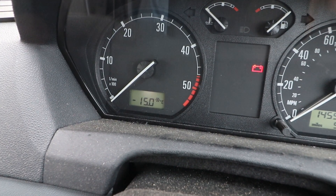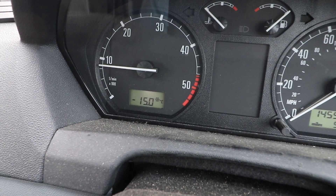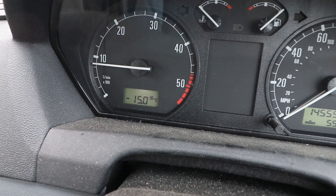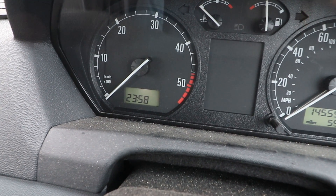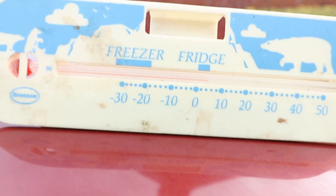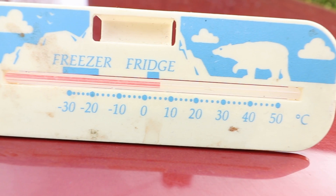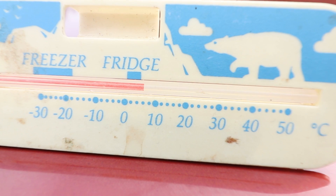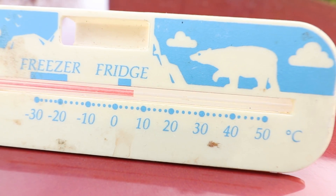Start it up to see if that makes any difference — no, it's just the same. I covered this in a previous video, so this is the video where I need an ambient temperature sensor by the looks of it, because it's faulty. Here's the outside temperature now, which looks around five degrees approximately, so minus 15 — I don't know where it's getting that from, so better check it out.